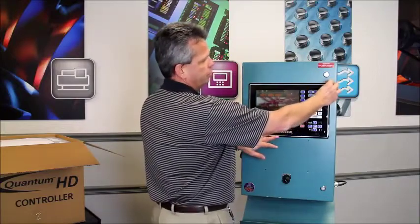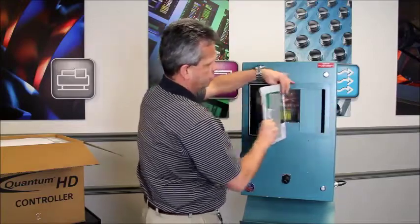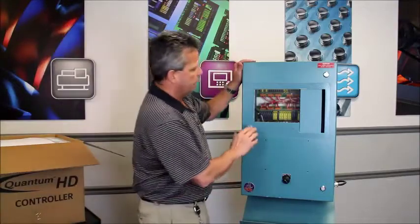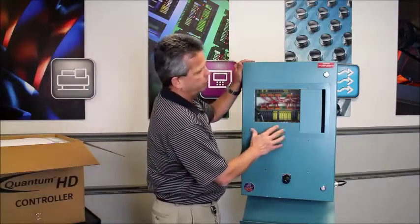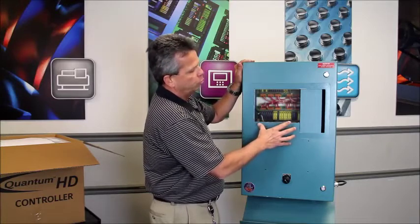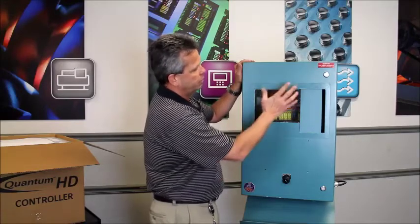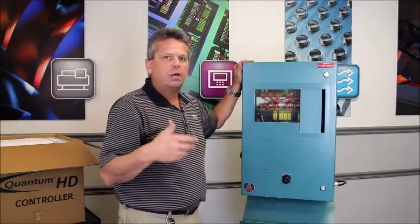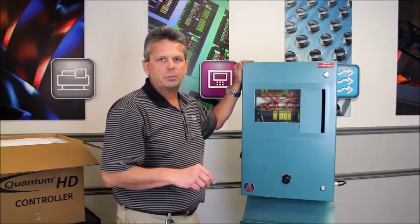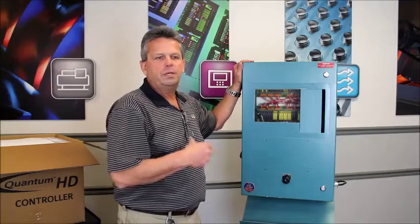Starting up in one corner, if you get it loosened up you can basically peel downward and across to remove the keypad. Now, as you'll see, there's a considerable amount of glue residue left over. You want to try to remove as much of that as necessary before putting on the template, because part of the template could stick to the door itself. You can use normal solvents such as Goo Gone or Goof Off, being sure to review the MSDS sheets with regard to personal protective equipment necessary when using those products.